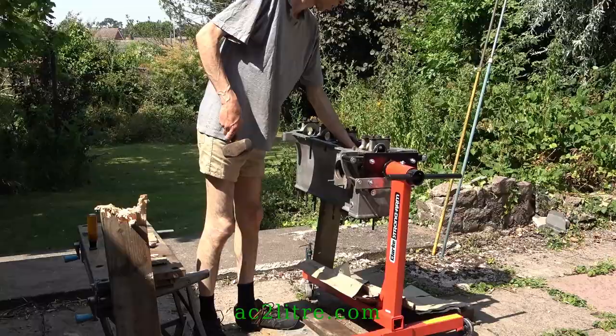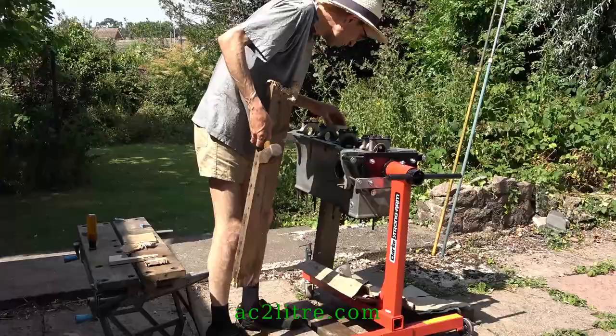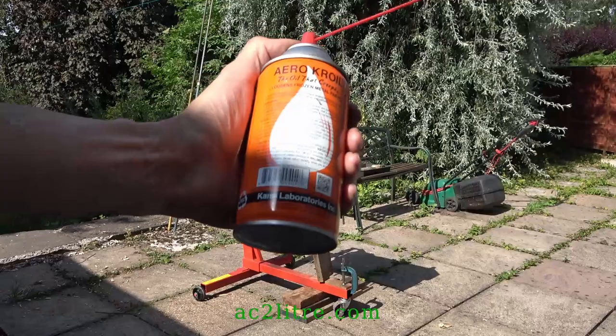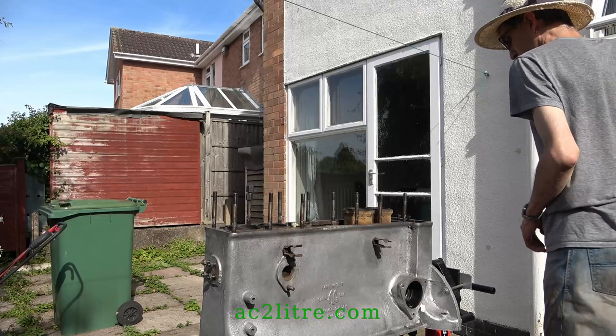Here I am on our hottest day on record, 38 degrees C or 100 Fahrenheit in the shade, but the engine has spent a few hours in the sun. Guess what? It worked. Look closely and you can see cylinders 5 and 6 poking out under the upturned engine. The ends of the liners are reduced in outside diameter slightly so that final removal is easier. Here you can see the part removed cylinder liners more clearly.